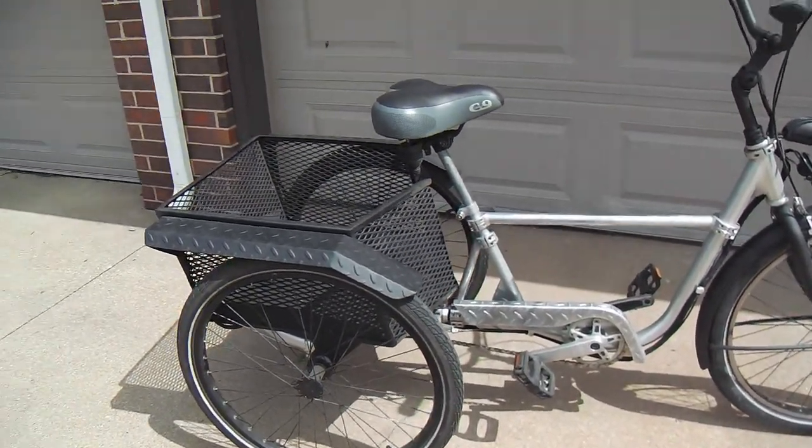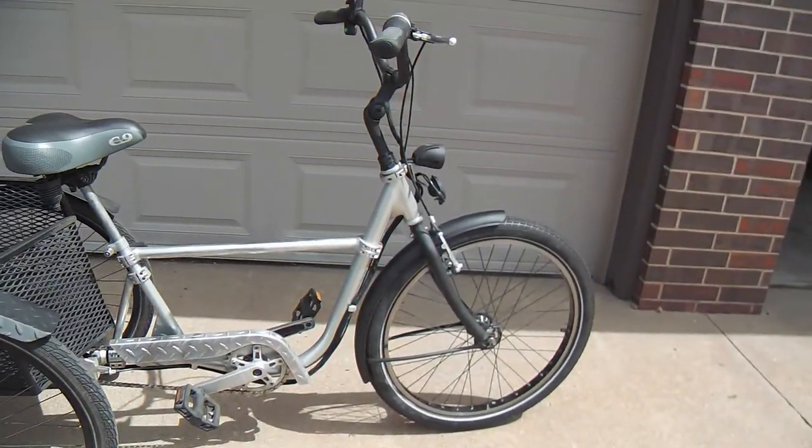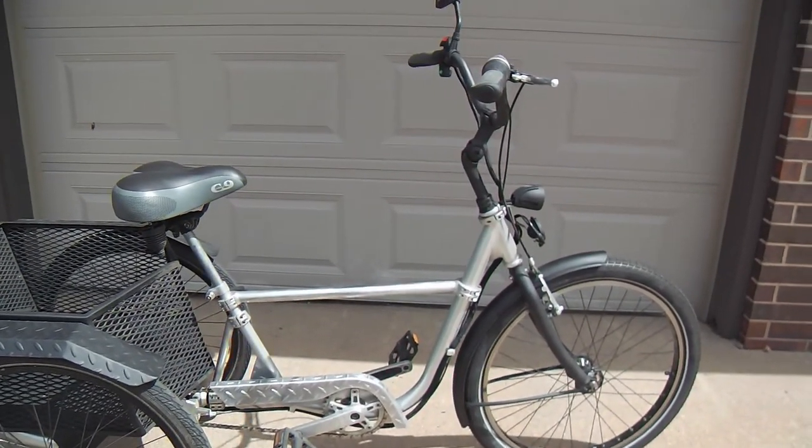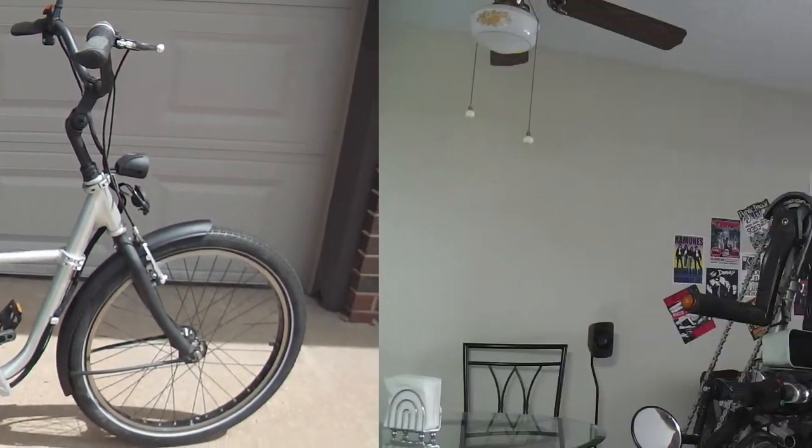But anyway, here's the trike, and you can see my approach to a lot of things and my attitude about how things can look or might look. I'm pretty savvy with these direct drive Chinese hub motors. Very simple. If you rip a wire out of the phase wires, it's easy to go back in, cut it, pull it out, stick it back in, and redo it. I think they're just the way to go. I really dig them. So anyway, that's the conclusion of the video.